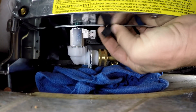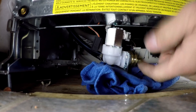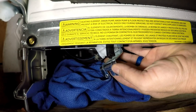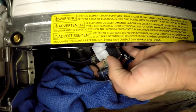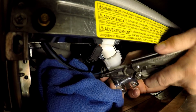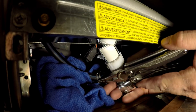I'm out of breath from running up and down the stairs. I just unplugged this — that's free on the top now. I'm going to get some other rags to shove in here, because when I disconnect this black hose back here, water is going to come out. And also water is going to come out when I disconnect this. This is much easier when you're not trying to film it, but it is kind of a limited space. This clamp right here, you just need to get a pair of pliers on that, squeeze it together and move it forward. Taking the dishwasher out would not be easier — it took me a long time to get this dishwasher in here.